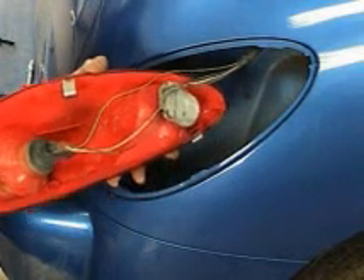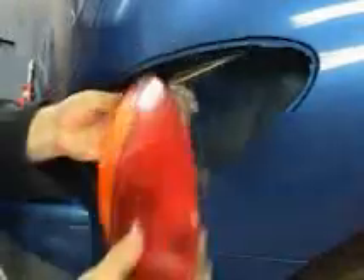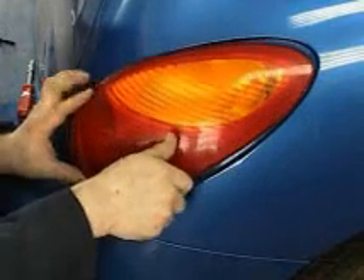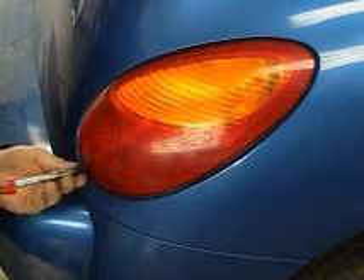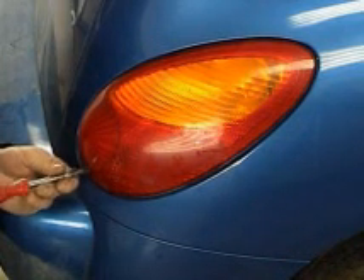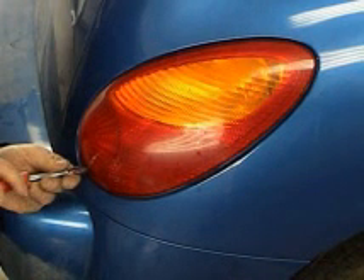Now that we've inspected our bulbs and ensured they're in good shape, let's go ahead and reinstall our tail light. It's a matter of going in slowly, finding the slots where it goes in, and pushing it. Hold it in place and reinstall your T30 screw. You just want to snug the bolt in, just so it's nice and snug — not over-tighten because we might crack the housing. And there we are. Hopefully we saved you a bit of money to do the job yourself instead of taking it to an expensive mechanic or body shop. You can do it yourself.